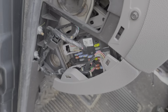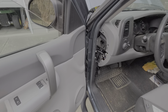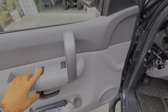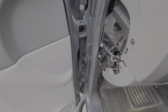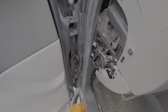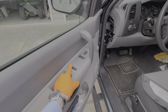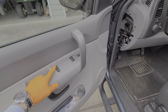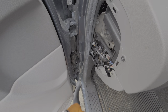I hope this information was a good starting point for you in troubleshooting the door locks on your Silverado. One other troubleshooting step: these door lock actuators, as well as the switches, receive power through a wiring harness through here. Every time you open and close a door, you're flexing all of the wires that come through here, and sometimes they can break. What I try to do is put the door at different positions and see if the switch responds. If I can hold the door at a certain position at which the switch starts to work, that's a pretty good indication that I may have a broken wire in there.